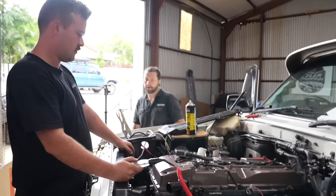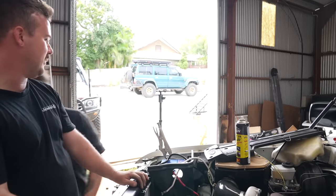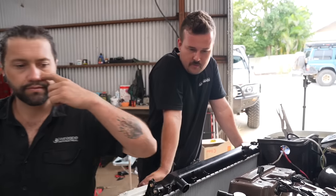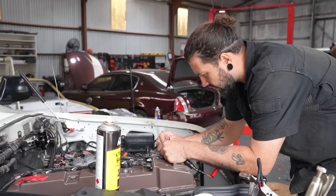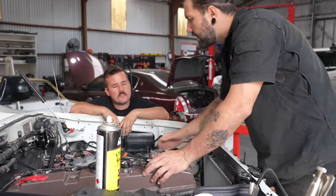So we've confirmed injection pulse — we're on the right track. We should have spark. The only reason we don't, if that's all off the same circuit, would be an immobilizer. We've confirmed no power or ground going to the coils at all. That led us to believe something isn't wired up. If it were an immobilizer, it'd still probably have ground or power — they wouldn't cut both. Diagnostics 101 — there's a lot of wires here and we're figuring it out. This is pretty normal for an engine conversion wiring situation.